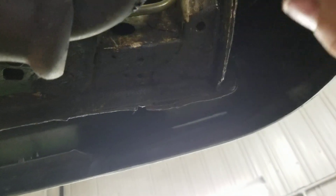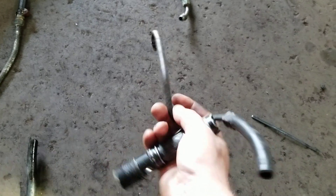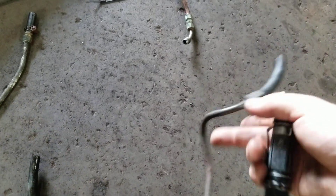There's one line on the cool side of the radiator — it comes down, loops over here, and it's actually the top line right here. A small piece of rubber hose bends up at a 45 and goes into the fitting on the transmission. That's a little bit different configuration from what I had originally. I changed it around so I could get the line in there the way I wanted.